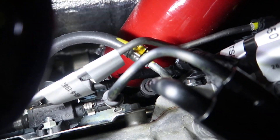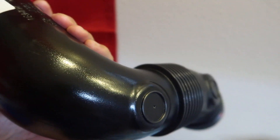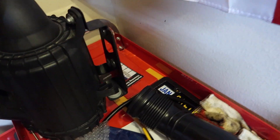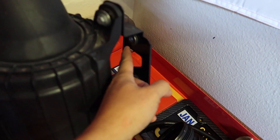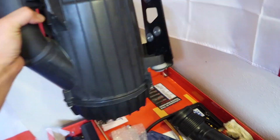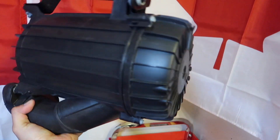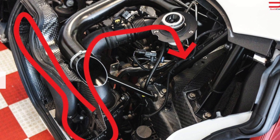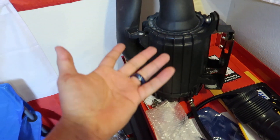You start off here, unfasten that — this is what's going to come out of your car. You take off the MAF sensor, and once you take that out this whole thing comes off. There's a bolt along the walls of the tub and the whole thing comes off. Look at this massive air filter that came off the car — usually you'd unbolt these bolts to replace the air filter inside. It really restricts the airflow going into the engine.